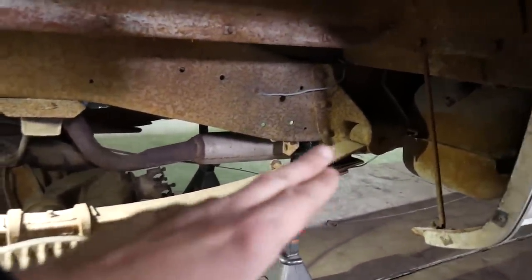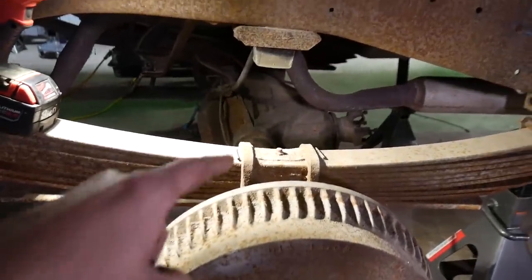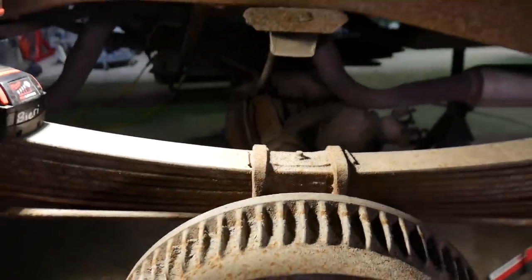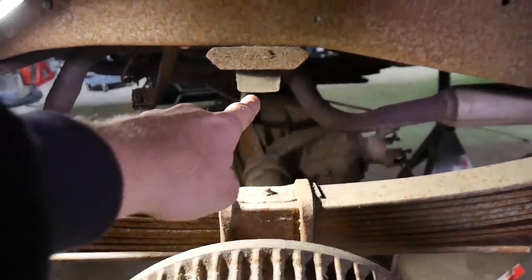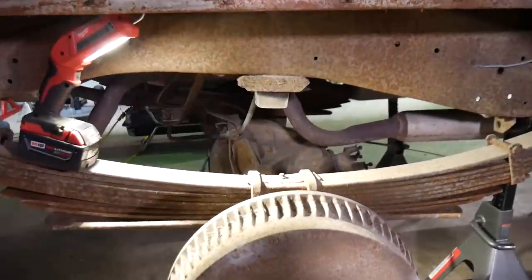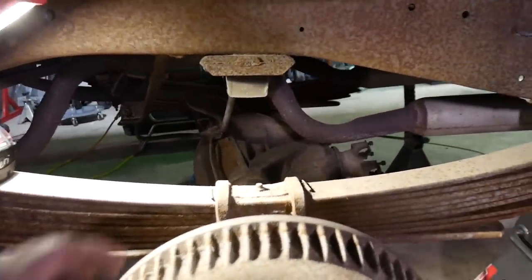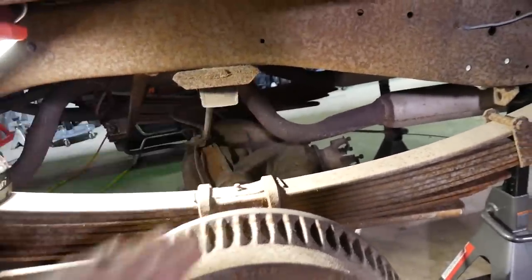Basic lever and a hinge point, and we know the leaf spring isn't gonna change in distance, therefore that is always going to stay center. And that center is right in the center of the axle tube. Being that point is never going to change, and that is where the factory put the bump stop, there's zero reason to believe that cutting exactly above the existing bump stop wouldn't be correct. I see people trying to move it around because they think putting the axle on top of the spring makes the travel different, but it's not.